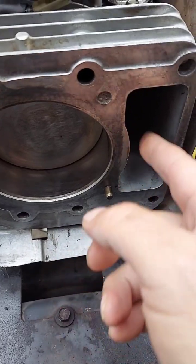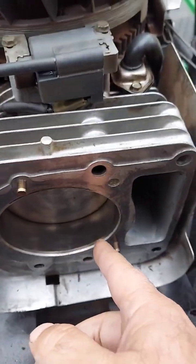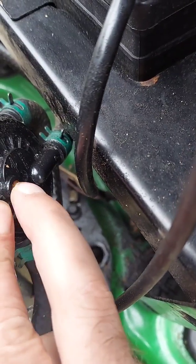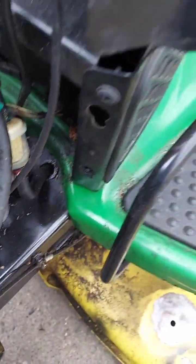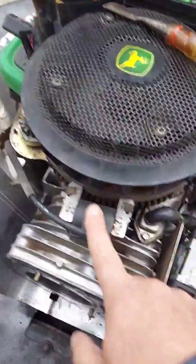The gasket was leaking, causing oil to seep through into the cylinder, which was blowing it out of the exhaust. But it was causing too much crankcase pressure, making it come out of the back of this little screen right here — this little brass-colored screen. Oil was blowing out of that and running all down here. I mostly cleaned that up; that was the issue.